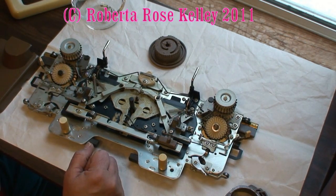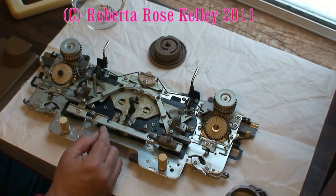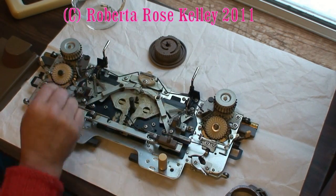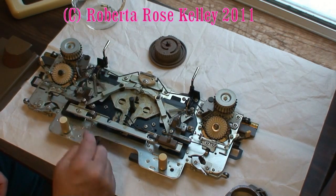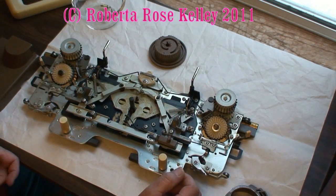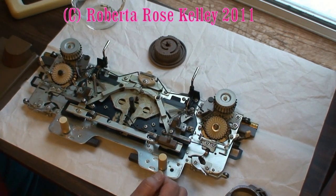Here, I would just take my lint brush from my sewing machine and get into these little nooks and crannies to get some of the lint out of there, or you can take an air compressor and blow it out. But you want to be careful — some of these little things, like these springs, are very sensitive. You don't want to be breaking them. As you can see, there's grease on there and a little bit of dirt that I'm going to clean.